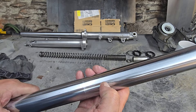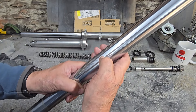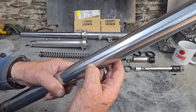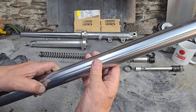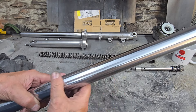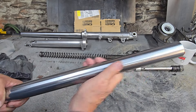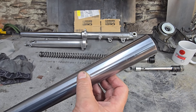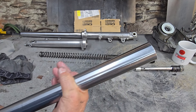You can if you're careful just lightly rub these down - nothing too much that it's going to reduce the diameter of the leg, just to knock off those high spots which may have caused problems with the seal. There are a couple of raised sections - if they're outside of the fork travel it's not so bad, but I suspect a couple of those are within the travel zone. The ones near the top we don't really need to worry about, apart from when we fit the new seal we don't want to rip it as it drags across them.